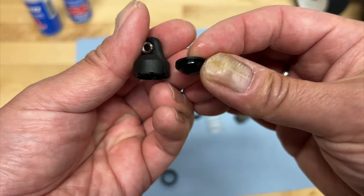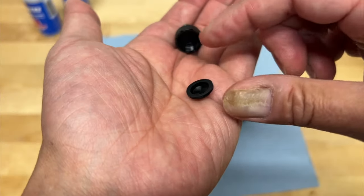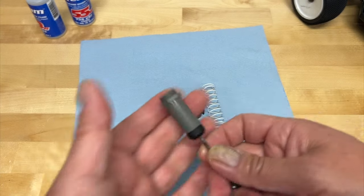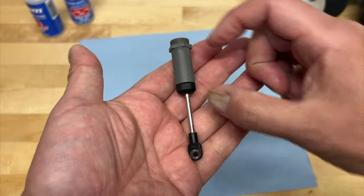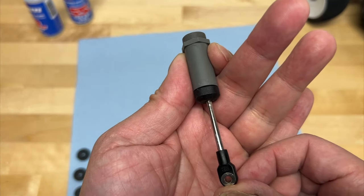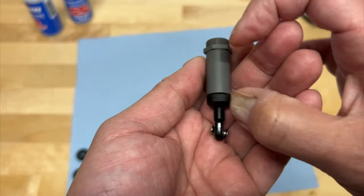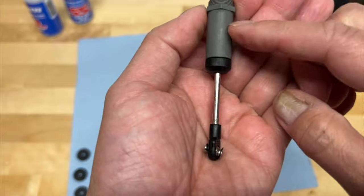The bladder also provides a pocket of air above it. When it's fitted inside the shock cap, you've got a little bit of air right there above the shock oil and separate from it. Something to realize with shocks — a lot of people don't realize this — is when you've got it fully extended, it's full of shock oil. Now if you compress it, if you push the shock shaft into the body, it's obviously adding space for that shock shaft inside the body.